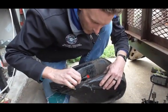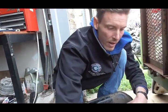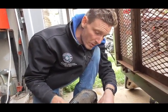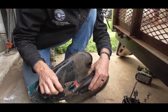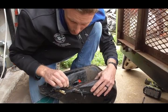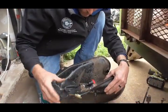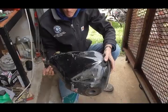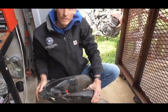It's really the rubber grommet that's repairing the petcock stem. One downside of this repair is you don't get a reserve fuel setting — if you're running low on gas you don't have that reserve option, which is not ideal for long road trips. But this will repair your petcock stem. As far as I know, no one else on the internet has made a video about how to do this. That concludes the video — this is the best repair I know of for cheap Chinese metal gas tanks where the petcock stem breaks off at the tank.